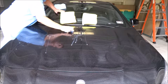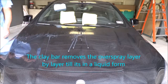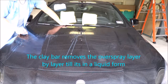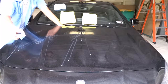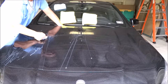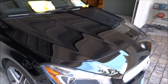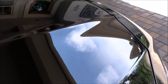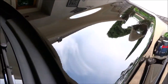Notice how you don't hear any noise? It's because the overspray is off. Put a little more on there, flip it over. I saved the best for last — the hood. Look at where I just clayed the hood. Look at that hood — that's beautiful. Again, no wax on this. I clayed through the wax, so there's nothing to cover or hide anything.